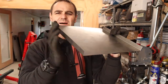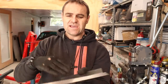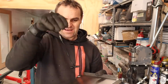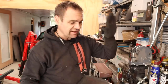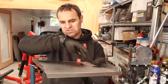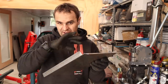I've folded up the edges — these are going to be the bottom of the tunnel. I'm going to curve this whole panel. I've put a little bevel on the edge because I want a sort of step down from the tunnel. You might look at this and wonder how on earth I'm going to get that curve, and that's where the shrinker comes in. By shrinking this edge it will curve the whole panel — I'll tweak it a bit by hand, but hopefully I can get just the right shape. Let's give it a go.